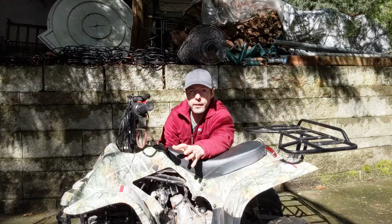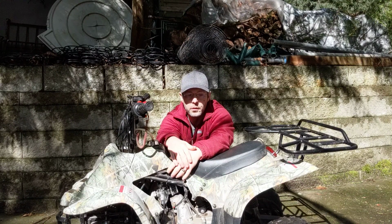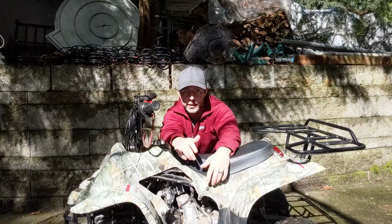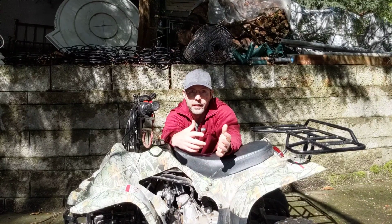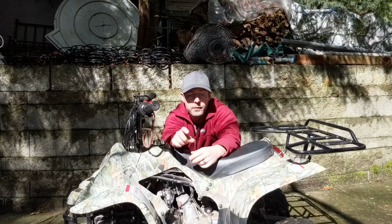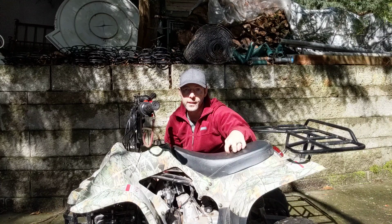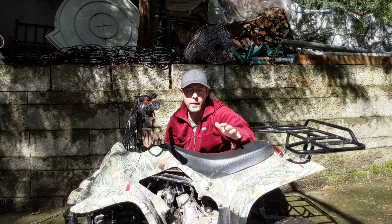Now there's only one other issue that I've run into with this, and that has to do with the battery. These batteries are really terrible. They're typically a 3 amp hour battery, and they go in a little compartment here underneath the seat. And it would be great if I could just store a huge battery in this thing, but I can't, because the cubby that it's got to fit in is small and limits it. So I found a battery that's slightly larger, only in height. It's 4 amp hour as opposed to the normal 3 amp hour, and it still fits in the cubby, and it's not too tall that you can't put the seat back on. So I think it's as big as you can go without having to modify this thing. And so far it's working out really well for me.